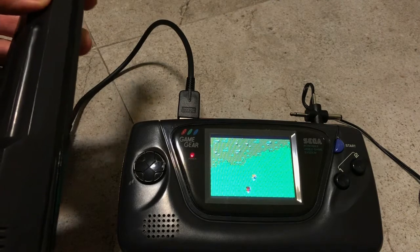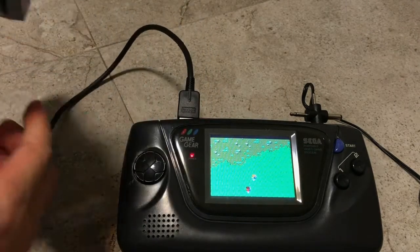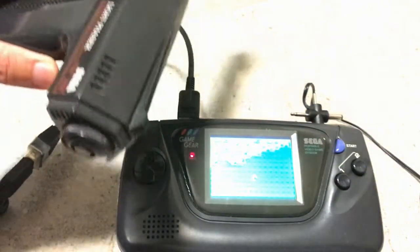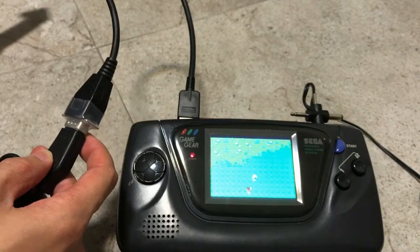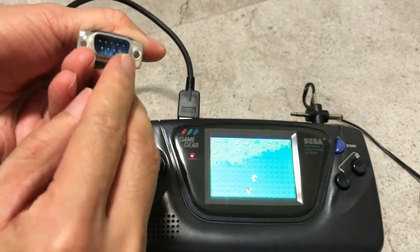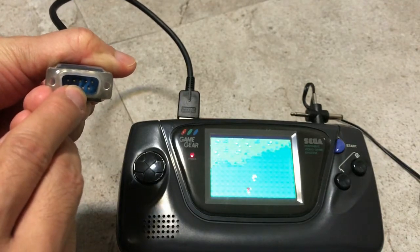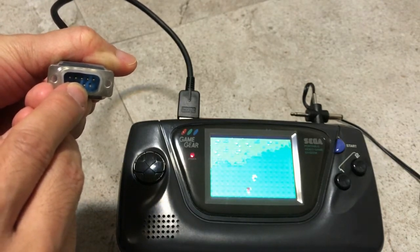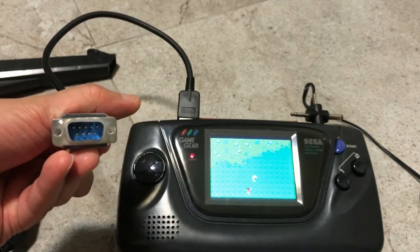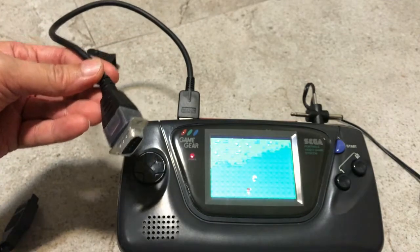But if we're going to play shooting games on the CRT, this light gun will require a 5-volt supply to power the diode — the light diode inside. I've rechecked and confirmed that the serial port here does not supply 5 volts to pin 5, which is where the 5 volts should be. Pin 5 is the top right pin, and ground is the bottom row second from the right. So instead of cutting the cable in half and trying to feed 5-volt supply to this pin using a power bank or an iPhone charger, I'm not going to break this cable.